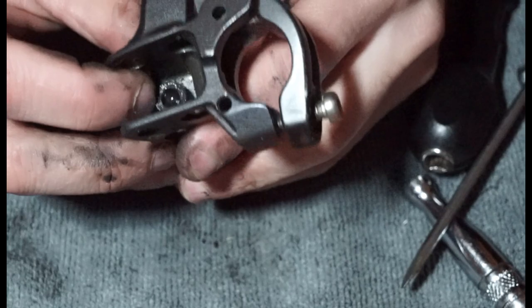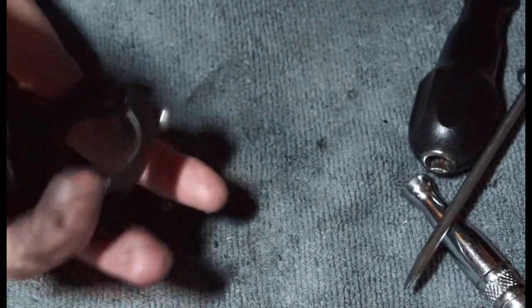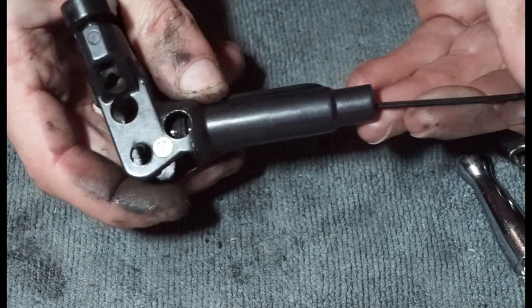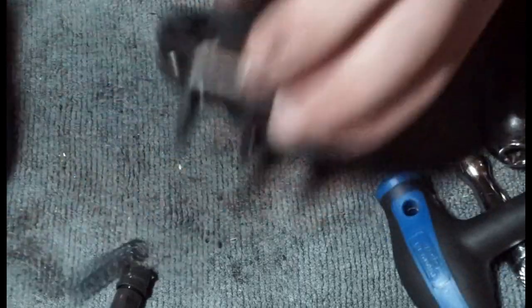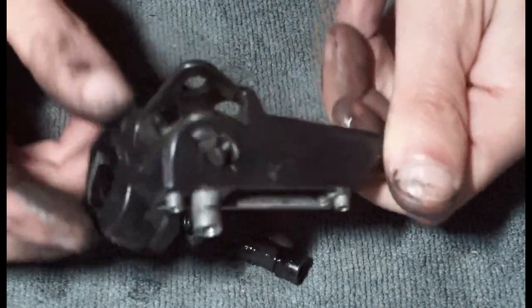And already your piston has started to come out. You might be able to grab it. If not, just get a small Allen key, push it in the end, and just be aware that you don't want to scratch the inside. As we do that, your piston should come out. There should also be a spring in there. Here we go. And then, if I get all this crap out of the way, that is your lever